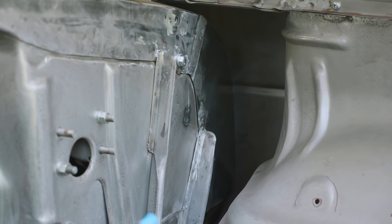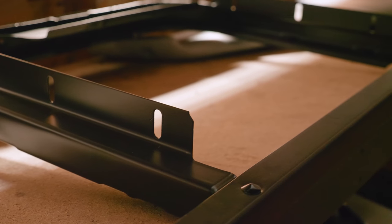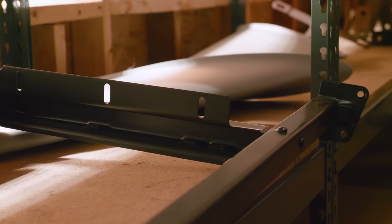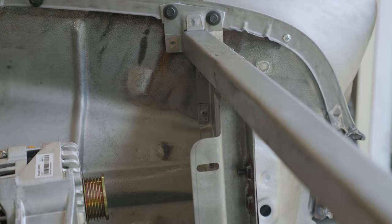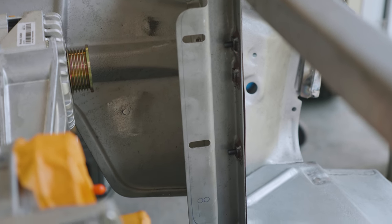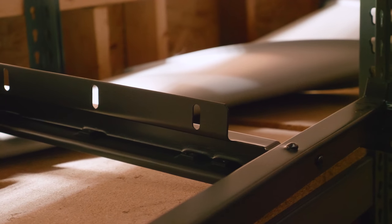It just gives such a better finished look. I apply this to more than just the pieces I'm creating — I do this on original pieces as well. Take this 55 Chevy Bel Air core support: this is for a strict restoration so I won't touch this one, and you can see the radiator flange here has a sharp corner that's going to stay that way. But on the Restomod 55 Bel Air I've been doing, I rounded that same flange corner off — it has such a better look. It just looks more finished, more time was put into it. And it has a second purpose: I don't have to worry about stabbing myself on that corner. If I'm working in the engine bay, mounting the radiator, I don't have to worry about catching my arm or hand on that corner. It's rounded off, it's softer.